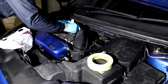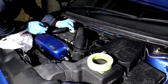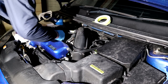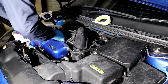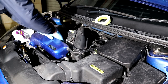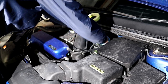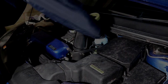The first stage is to mask off all electrical sockets and plugs. This relatively quick and effortless precautionary measure is simply going to ensure there is no risk of damaging the electrics. Luckily there aren't that many exposed electrical sockets on the Focus's engine bay, and in all honesty you more than likely wouldn't cause any damage if you didn't complete this stage, as most modern engines are built to withstand a certain amount of water. I like to do it as a precautionary measure and I would recommend that you do it too.